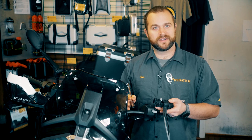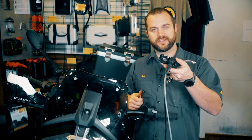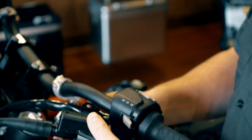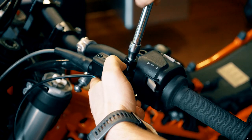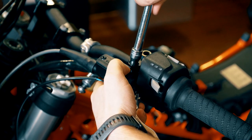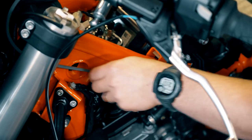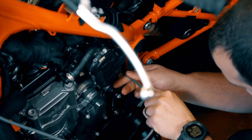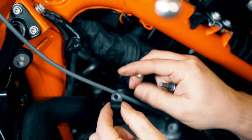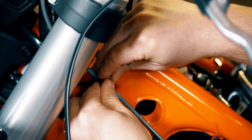We are now reassembling the motorcycle with new parts. Grab the complete Hymec clutch kit, remove the eight millimeter head bolt, and position the master cylinder onto the handlebar with that one bolt — keep it loose, just tight enough that it won't fall off while we're working. Run the slave cylinder all the way down through the exact same path that the OEM clutch cable took. Grab the two clamps you removed from the stock clutch cable, slip them over the hydraulic hose, and install the bolts loosely in their two positions — one up by the steering head and one down below by the rear shock.